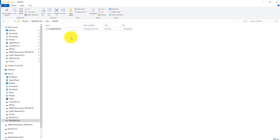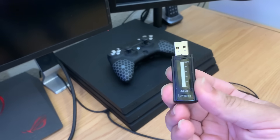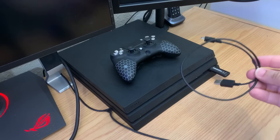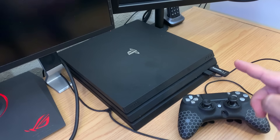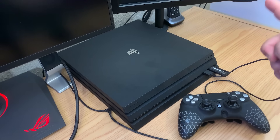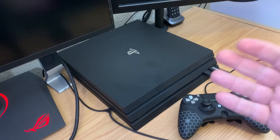I'll show you how to go into safe mode to apply the PS4 update. If your PS4 boots up with a message asking you to plug in a USB with the latest update file, leave the USB drive plugged in and boot up normally — it should find the update file and get you back to the home screen. Also plug in your PS4 controller with a USB cable. If the normal boot method doesn't work or you have a different error, I'll show you how to go into safe mode to install the update manually.